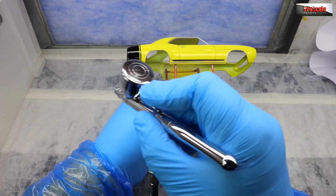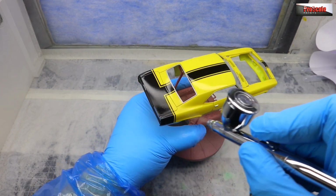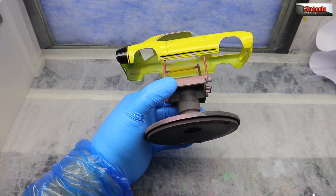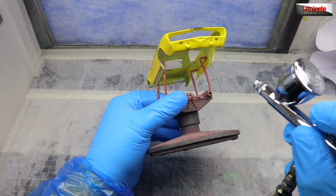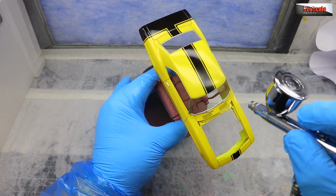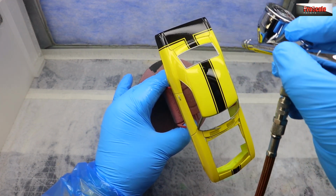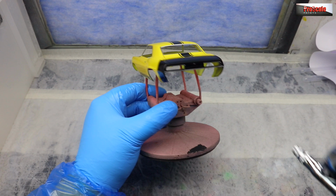And when doing our last coat here now, the 2K will self-level absolutely beautifully into our nice foundation of tack coats we already put down previously. So I've tested all the different ways of using our 2K, and this one is the most beneficial and it works the best. So I'm just going around putting a nice even coat down.